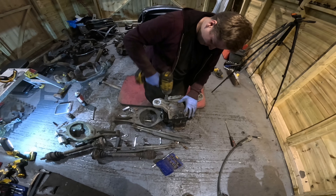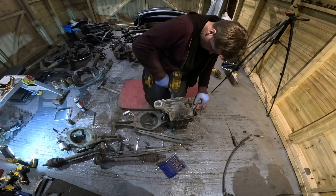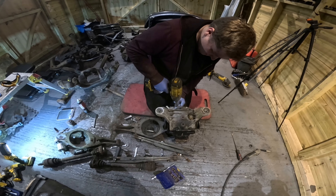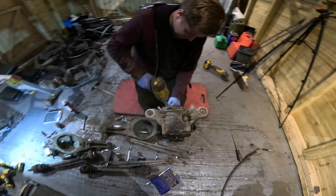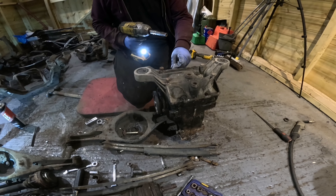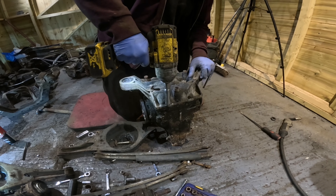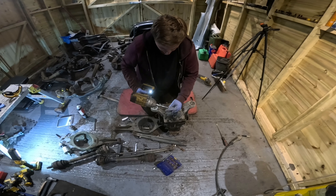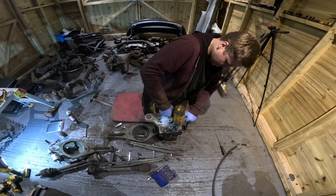We're left with the little covers - pop those off. That's where your ABS stuff lives. There's a little grommet in there you just knock through, and this pulls off. When you're stripping your subframe and sending it for powder coat, have a good look - these areas love to corrode all around here. This one actually looks terrible but it's solid. If yours has any signs of holes or particularly thin metal, just bin it - it's not worth using something that's rusty.